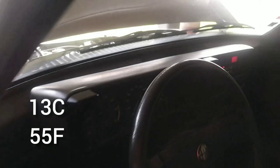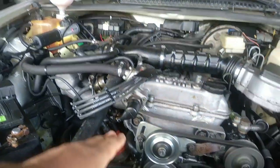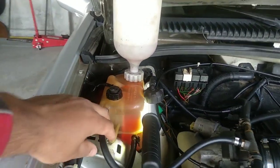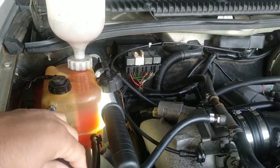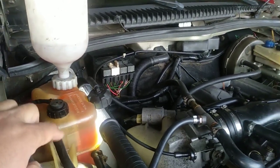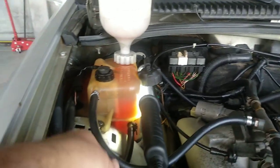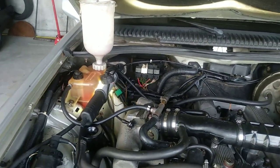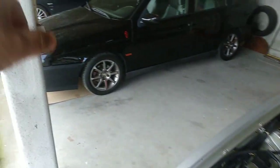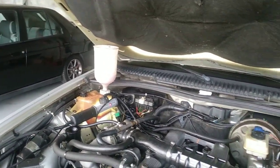Let's wait until this second circuit opens, and then we must watch the level drop down to the proper level. Meanwhile, this return hose here must be hot. This return hose must always bleed out the antifreeze — it must be working at all times, this one and the lower one as well. This principle of working is the same for the Alfa 75, Alfa 33, Alfa 155, 156 — all cars that use liquid cooling use this principle.